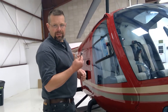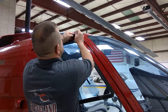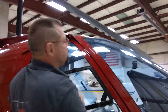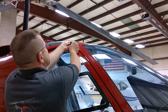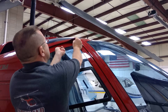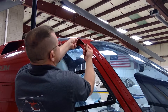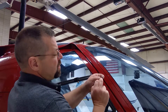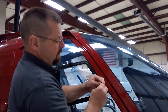You'll need two 7/16 wrenches. You've got one bolt to remove up here and it has a nylock nut on it. Once you get past the nylock, you can use just your fingers to remove it. With the door latched, the ram already off, and the strap off, the latch holds everything together until it's time to pull the door off. Pull this bolt out — there's a little spacer that goes between the top of the door hinge and the bottom of the hinge on the aircraft. Put them in your pocket so you don't lose them.